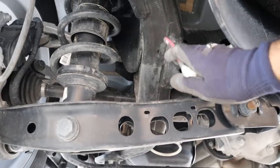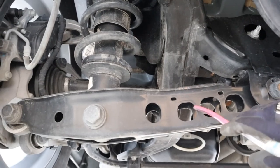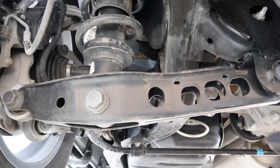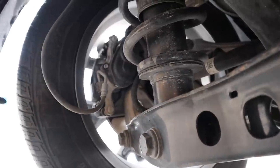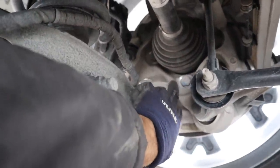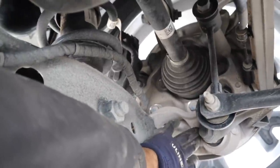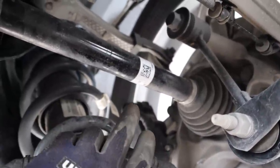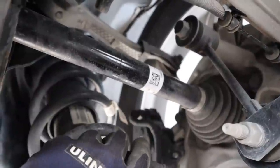Take a look at the structure here — you can see this is the frame itself; there's no subframe holding the suspension components — they're all bolted directly to the frame. Here's the rear lower control arm that holds the strut — it looks like Swiss cheese because they want to save weight, although salt and snow is probably going to get stuck in there, and there are no drain holes on the bottom, so it'll probably rust out soon. I don't like how this brake line is so loose and can easily touch the wheel — they should have tied it up somewhere. The rear suspension bearings in the back here are also a bolt-on design, so when they do wear out you don't need a press to change them. The knuckle here is made of aluminum to save weight. Here we've got the rear CV axle — you can see it's a nice chunky size, especially on a rear-wheel-drive-based V8 vehicle — you're definitely going to want a beefy axle.